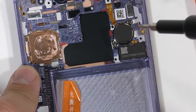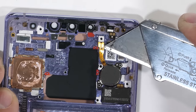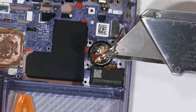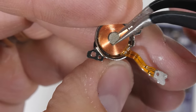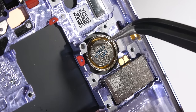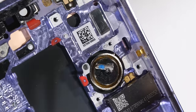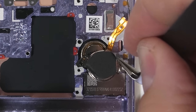Now let's take a look at the under-screen earpiece. Notice that the speaker is screwed into the frame of the phone — this helps the component vibrate the frame to produce sound. Popping off the top we can see the coils of copper wire inside the cap, which rests against the magnet still attached to the frame. It really is just like a normal speaker, just beefier, with enough guts to vibrate the frame of the phone and produce the sound for your ear to hear — all of this happens through the other side of the display.